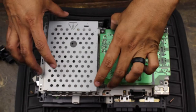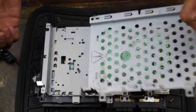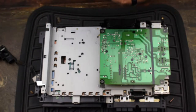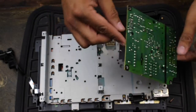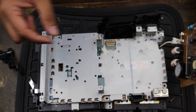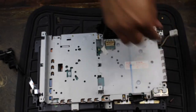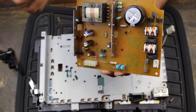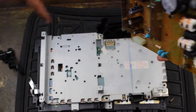After you get those four screws, lift up gently and remove the protective cage for the optional hard drive. As you can see, it's a little dirty in there. Set that aside with the rest of the covers — I'll wipe it down with a rag and some Clorox wipes. Next, move the power supply and fan out of the way, gently push up, and it'll come loose. Turning it over, you can see it's a bit dusty. There are two connections here — this one is for the power supply, so pinch it and pull it out. There's the actual power supply board. For this board, use a microfiber towel or a can of compressed air — you definitely don't want to run this into water. Set that one aside.